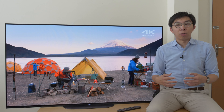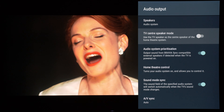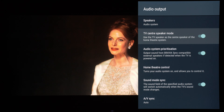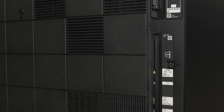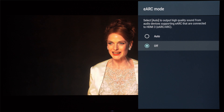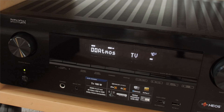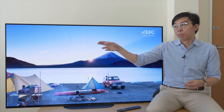The connections are found on the left rear of the television, including spring clip terminals for the Acoustic Surface Audio Plus speakers to be used as the center channel in a surround sound setup, as well as four full bandwidth HDMI 2.0b ports with HDCP 2.3 compliance. The only HDMI 2.1 feature implemented on the Sony AG9 is enhanced audio return channel, or eARC, on HDMI input 3, and you will have to go into the user menu to enable it specifically. We tested eARC using a Denon X3500 receiver and it worked well, passing Dolby TrueHD Atmos soundtrack from 4K Blu-rays through the TV's HDMI 3 port.